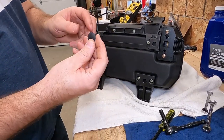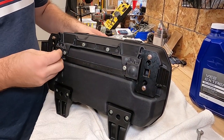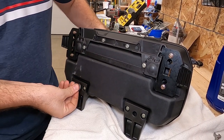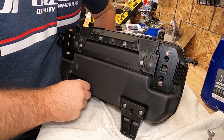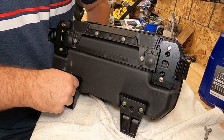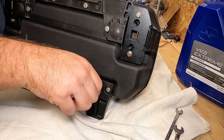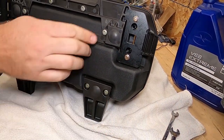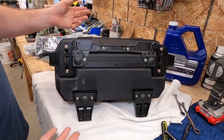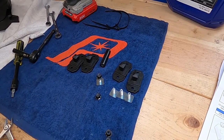Your next step is the rubber grommets that go in. You're going to do one in here — just twist them into place. The installation manual suggests soapy water, but give it a good turn and a little bit of a push as you're doing it. Once you've got all 4 in there, that just protects from rubbing the tunnel. Now that we're at this point, the bag is all taken care of, and we're going to move on to the sled for the mounting posts.